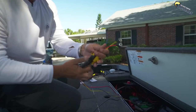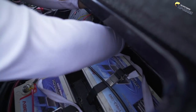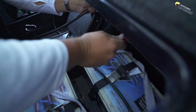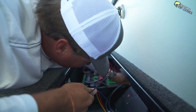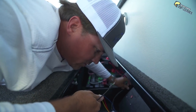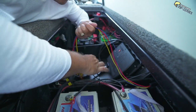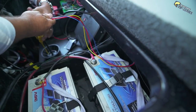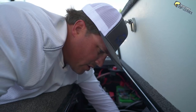Red, blue, and yellow right there. We're going to hook that up on the positive side of my 36-volt lithium battery and run it back. We want all these wires to be somewhat organized. What I'm probably going to do to clean this up is zip tie these two mains over on this side. Of course the negative is going to go on the negative — pretty easy to figure that part out.